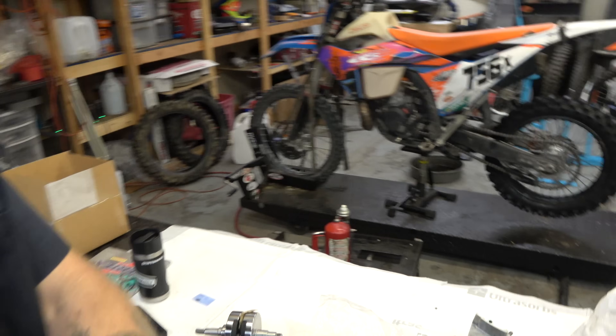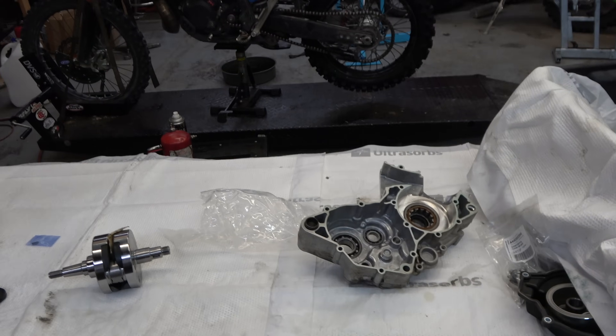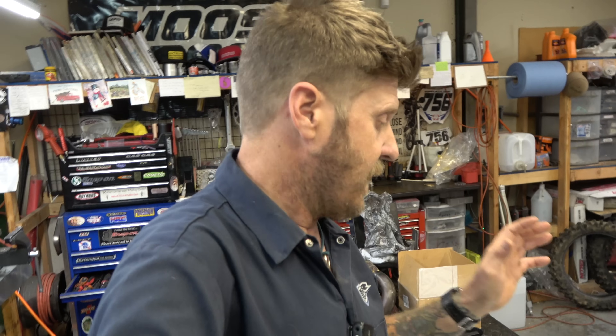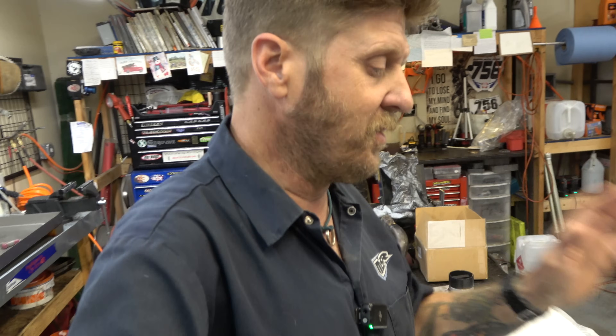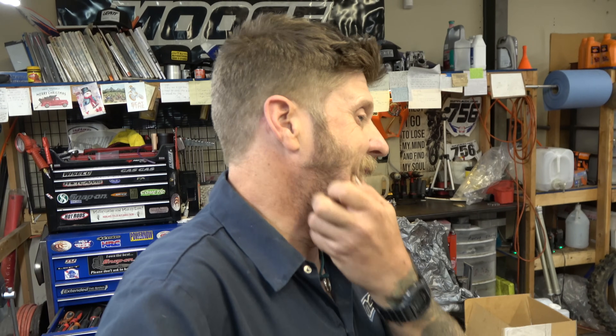First on my lift of the week is this KTM 150 SX. The last year of the carbureted 150 or 125 was a '22 — I had a '21, mine was brilliant. The '22s had problems with the crankshafts coming apart, and KTM fixed it by asking for your ECU back and reflashing it to set a rev limiter. I don't know that any two-strokes ever had a rev limiter before — that was a weird way to fix the problem.